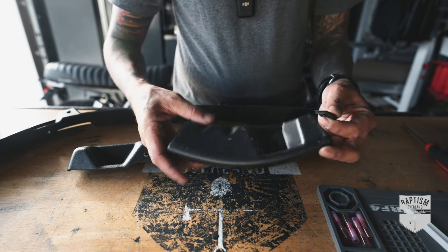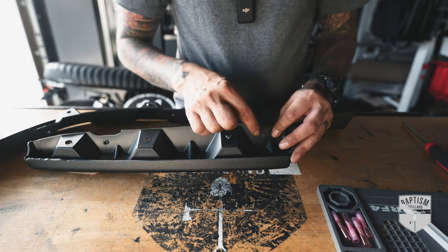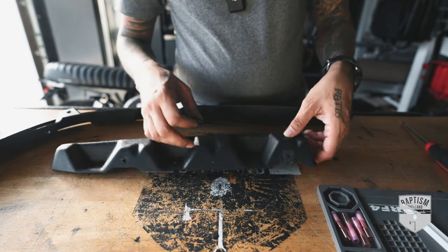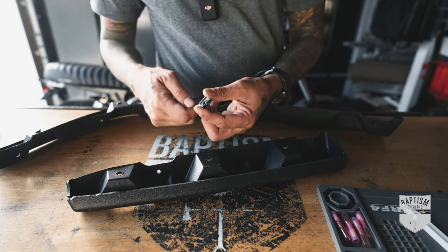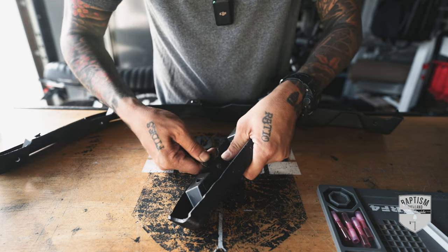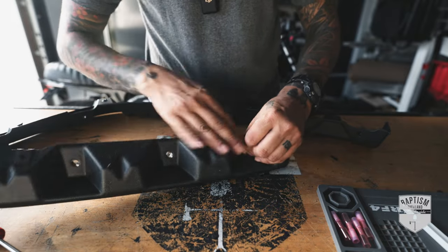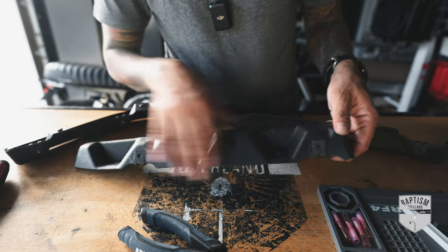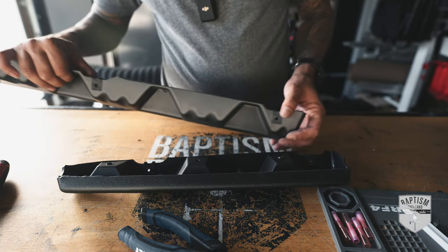D stands for driver's side. Parts that say P on them — like P6 or P9 — are for the passenger side. So just look for anything that says D and you'll know it's the driver's side. The first thing we're going to do is add these little clips to the edges. The D9 piece has nothing to add, so you can put that aside. The clips are what allow you to put a screw through and hold the fender in place. One side has a raised area that the screw will bite into; the other side is flat. The flat side goes to the outside. The best way to get these on — because they are a bit tight — is to split it slightly with a flathead screwdriver to open it up, then jimmy it in there until it bites, and slide it until the holes line up.